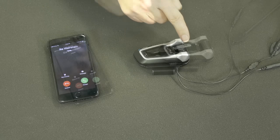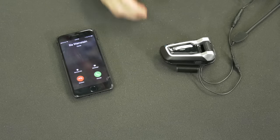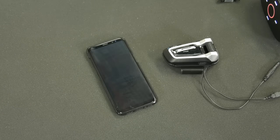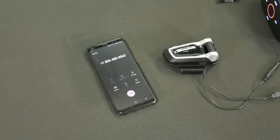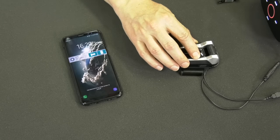You can do all these things using button operations as well. To answer an incoming call, press any button. To reject, press any of the three front buttons for two seconds. To ignore an incoming call, quickly swipe the roller both ways. You can choose to share an active call with your riding group by pressing the intercom button — this works in DMC mode. To end an active call, click either the roller, phone, or media buttons. To access your smartphone's personal assistant, click the phone button once. Double-click the phone button to redial a number, or press it for two seconds for speed dial.